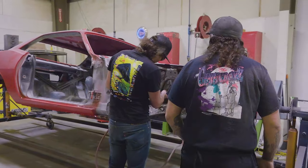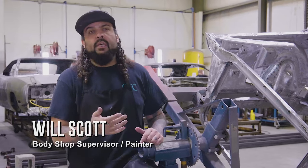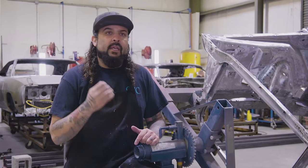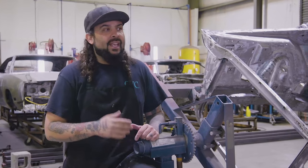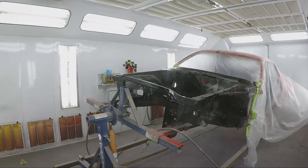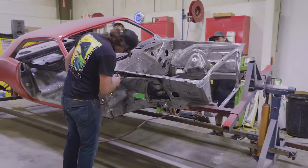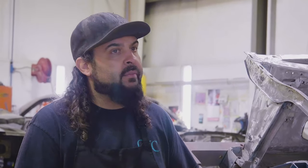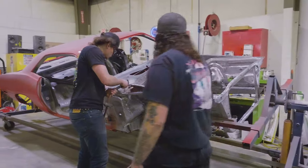The pre-paint sanding is coming off pretty easy. I go back and forth with this sometimes — I love it, sometimes I hate it — but ultimately I love doing it because there is no shrink-back, no swelling, no issues in the final paint. The car is covered, and it makes the final paint job go that much quicker. If you do make a mistake and see something you missed, you fix it up, put it in the booth, and the final paint just comes out beautiful every time. We have a new guy who just started, and I took him through some of the issues that need to be addressed in the engine compartment — basically stripping it down to bare metal, which is the best way to start so you can really see what you're working with.